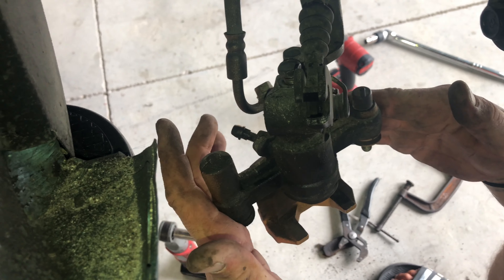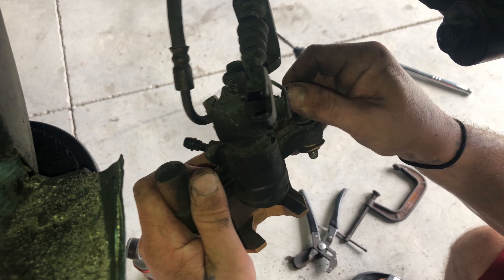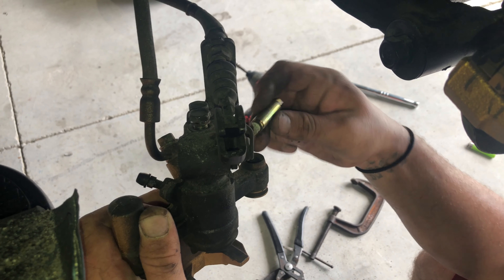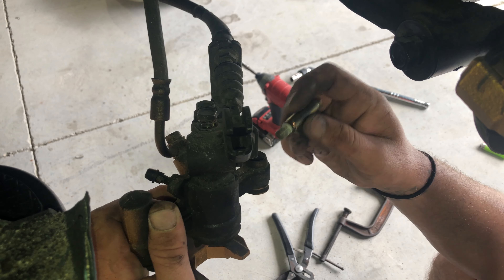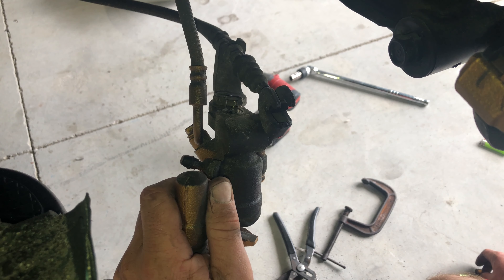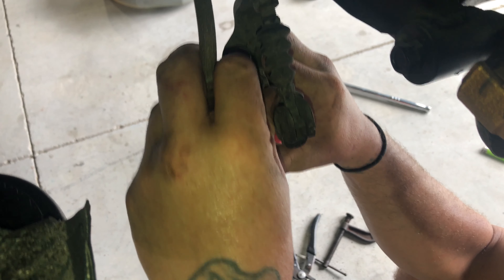Unlike most cars, the rear calipers on this Miata are a little bit different. What you want to do is remove this cap — underneath it is a 10mm bolt. You want to pull that all the way out, clean it up real good, and make sure it's not pitted. Before you put this back in, you want to throw some type of high-temperature grease on it. In order to release the tension on the caliper piston, there's a bolt up top that you want to take out.